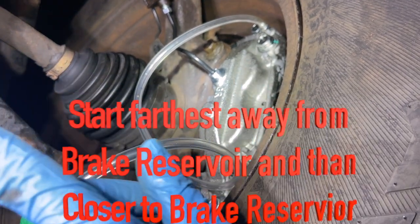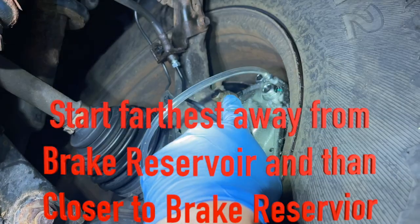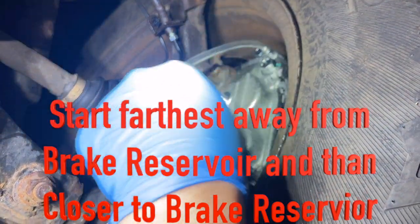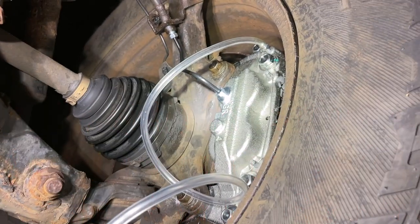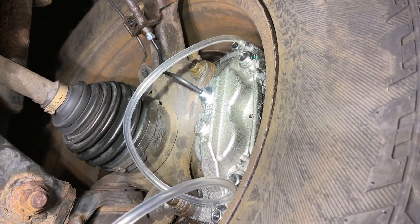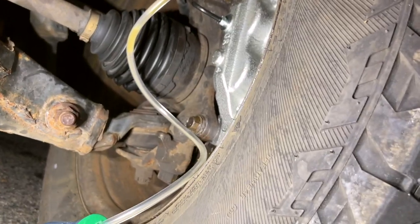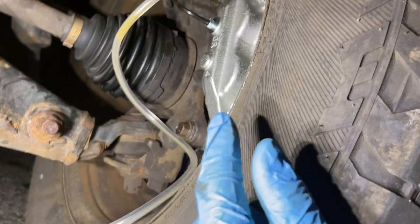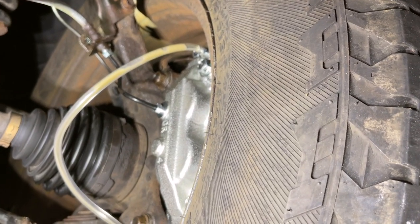And we're gonna repeat the same thing on the other side. All right, so pump, hold, and we're gonna release, and then fluid's gonna gush out. That's how we're gonna get air out of the line. Just for you folks. That's what she'll look like, you know. Now the fluid's coming through, goes straight to the bottle, and we'll keep doing that until this thing is primed and air is out of there.